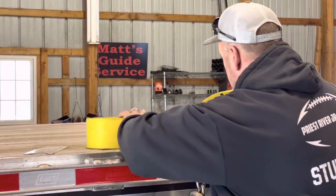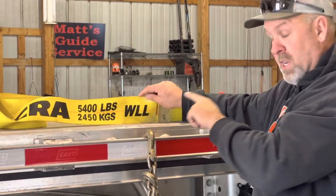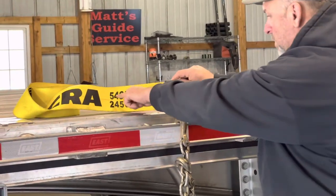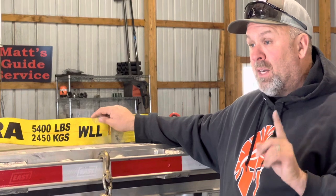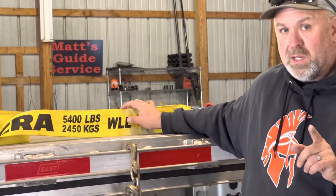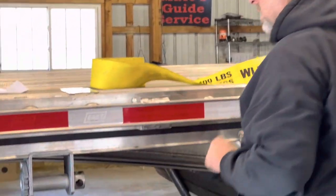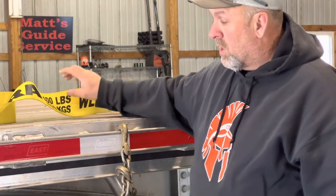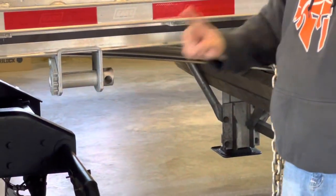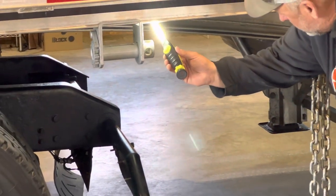But this strap is marked, and most of the new ones are, and they're a lot stronger nowadays. You can see this strap is actually worth 5,400 pounds working load limit, or 10,800 pounds worth of cargo. So if there isn't a weaker link in the system — this strap could be worth 5,400 pounds, but if this roller is only worth 4,000 pounds, which a lot of the older rollers used to be, then it doesn't matter what the strap is worth. They go by the weakest link. However, this roller is 5,500 pounds — the new trailers are a lot stronger. This is a 5,500-pound roller, so it's actually worth more than the strap.